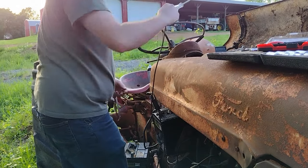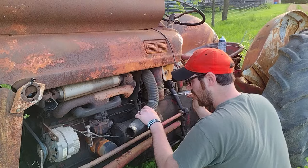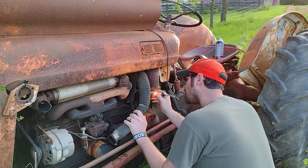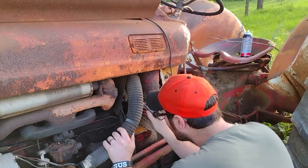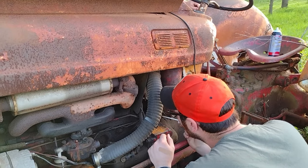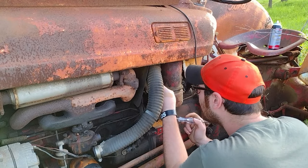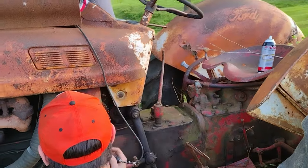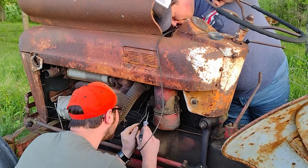Let me check the bypass switch altogether. I got the cylinder. Check it. That's okay. I got juice here. I know this juice is going to be there. Oh, well. I just figured it out. Really? Yeah. So we got a wire off? This wire is just rusted off. And that's the one coming off of the ballast resistor. It is? Yeah.